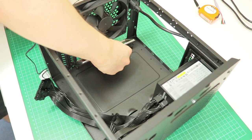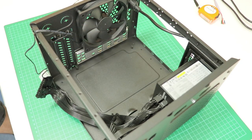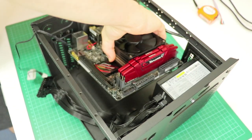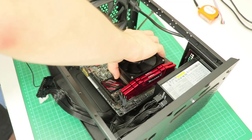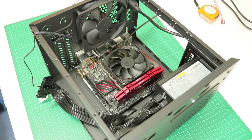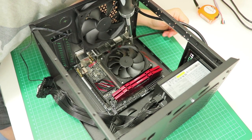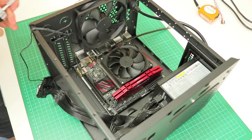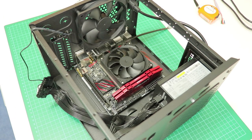So popping the motherboard in was a bit of a squeeze. If you're going for an ATX power supply unit, then you'd want to install the motherboard first. There are only 4 fixed motherboard standoffs without the option for installing more, which makes the thought of installing a Micro ATX motherboard even dodgier, since small Micro ATX motherboards generally require 6 standoffs. They're only simple standoffs, not standoff posts, so they won't hold your motherboard in place while you fix the screws, but this is a budget case, so it's hardly a negative.